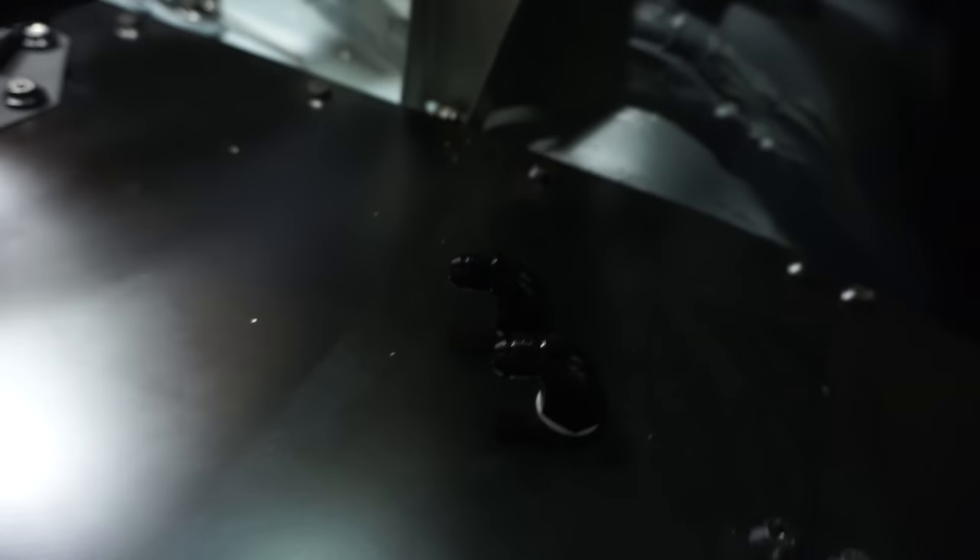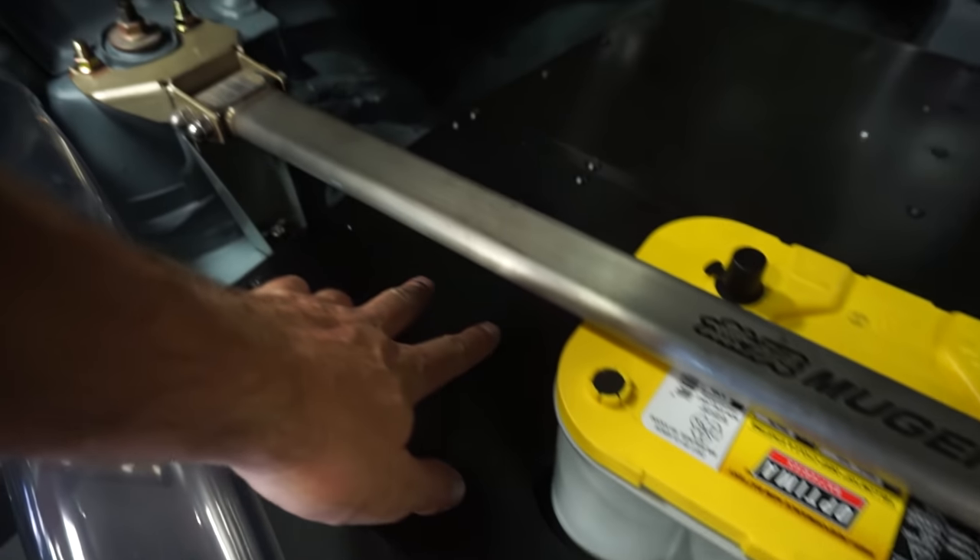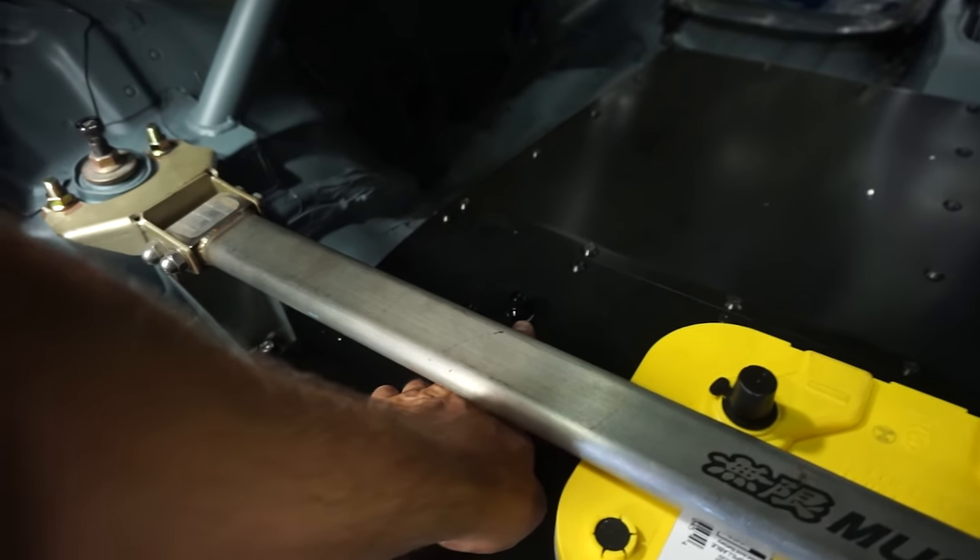All right, that's how these are going to go — kind of hard to see in here, but you get the idea. Two 90-degree elbows that are going to allow the fuel to pass through our aluminum plate and take a nice direct route over to where they'll hook up. Now I have to go underneath the car and tighten them down.